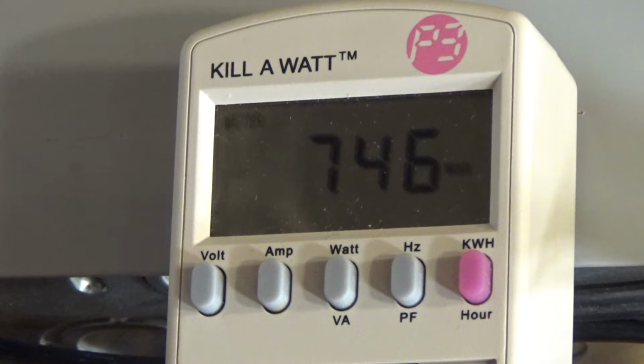And we'll go to high fan. Well, actually, I guess we could calculate what the fan draws on low, because if it's 763 on high, I need some paper. 700. Where's the pencil? Oh, jeez. Now I have to doubt what the numbers were. Okay, so we're at 764 watts. That's for high. Oh, now it's 765. Okay, now we're going to go to low. What? 66? Alright, 65. Now we're low fan, low heat.